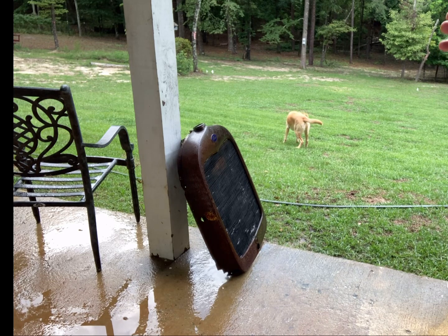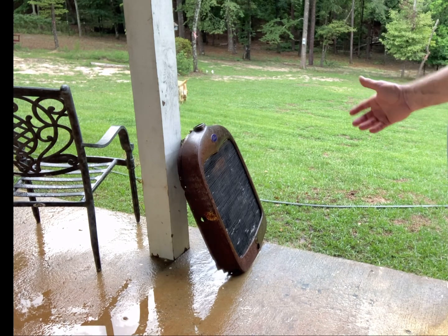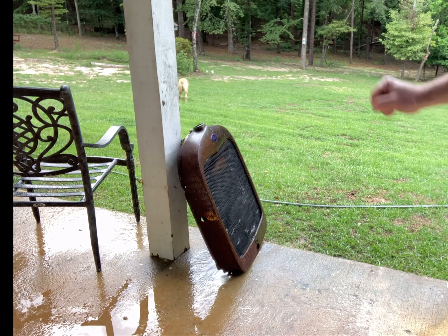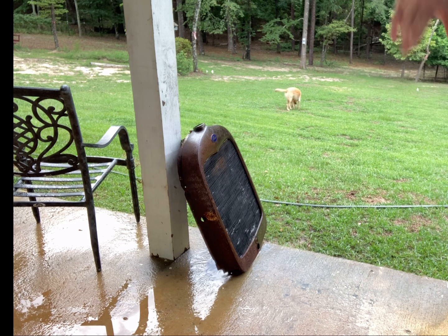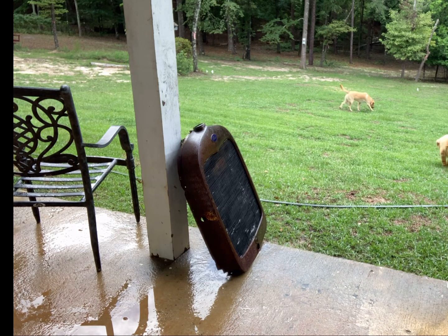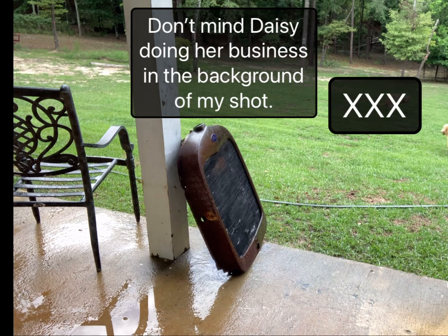Okay, I'm gonna let it dry off a little bit, and I may try to put a plastic bag over the inlets and fill it up with water, see if it leaks out anywhere, and kind of test it. Right now it'd be okay to run. Eventually I'd probably need to take it to a radiator shop and have them really dunk it in their tank and boil it out, whatever they do. But for right now, I think it would actually work as long as it doesn't leak too bad. So I'm gonna leave it out here for now.